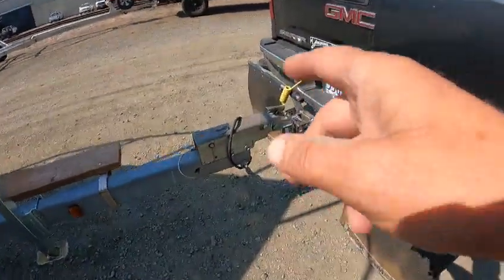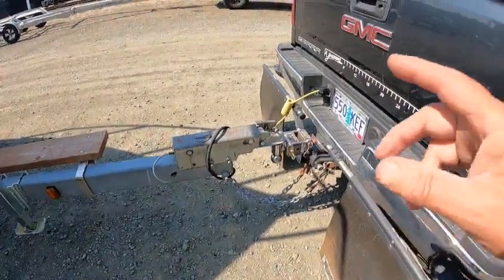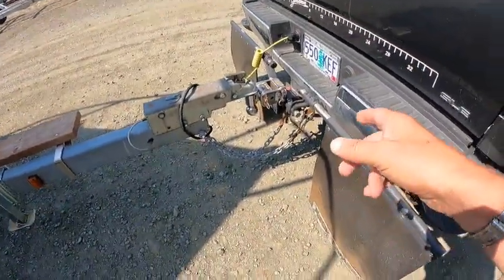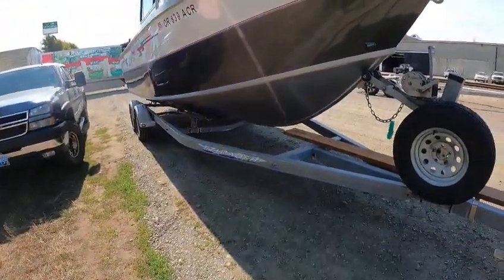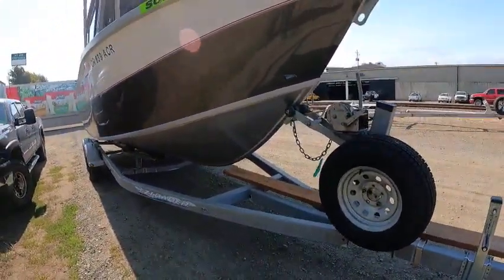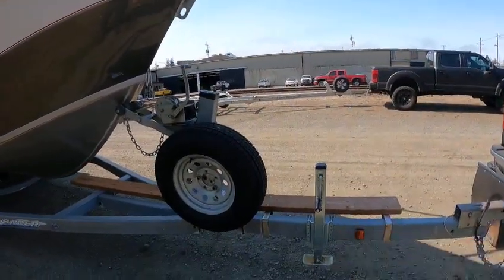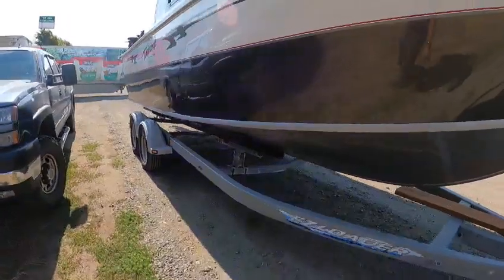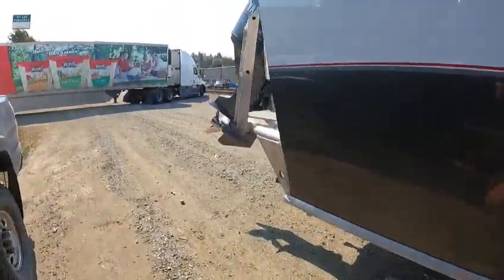Trailer brake - for your handle, so if it comes off you can slow that down while you take that off. Got a plank, spare tire, foot jack, good top-mount coupler. I did add brake fluid - they may want to check the brakes. Flat five on the trailer wires, safety chains, slicks on the bunks. If this is high tide, you may want to tie another rope off up front down to the trailer so it doesn't slide off.